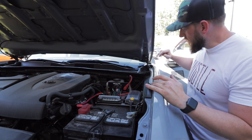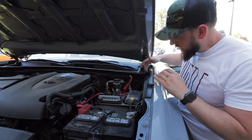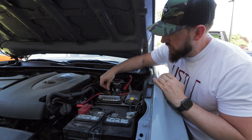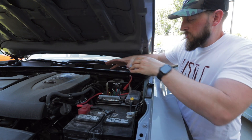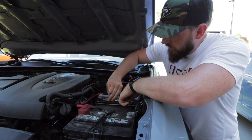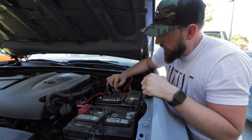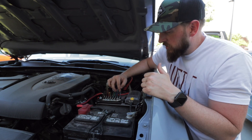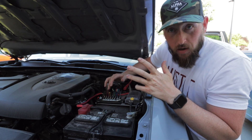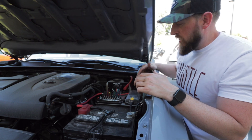As I've previously done with my ditch lights, I ran most of the wire up underneath the plastics and then came up underneath and hooked it into the Switch Pro. I'm going to disconnect the breaker from the Switch Pro so there's no power running while I work. Then I'll remove the negative bus bar cover — we'll be tying into one of the larger amperage sections of the Switch Pro, utilizing one of slots five through eight.